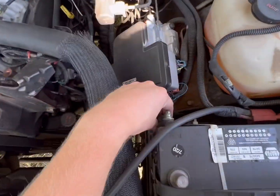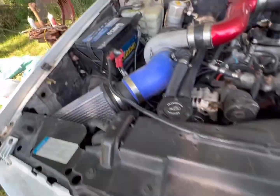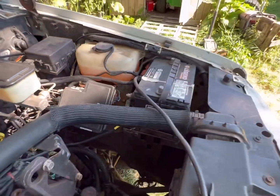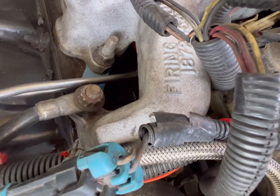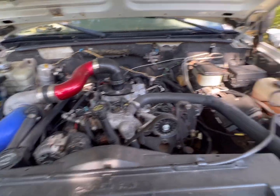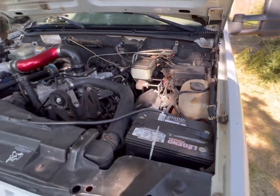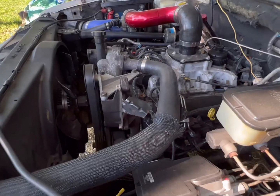We're going to start with the two battery cables. Make sure your crossover cable is good — it's not just a ground thing, it's a power thing. If these cables are torn up, you'll have issues. I always replace the grounds with ones from Tractor Supply; they're universal 36-inch. I re-ground them back to intake runner 1 and intake runner 2. That takes care of your battery and is the main source of your headaches. If you have a hard start issue or a slow crank, check those grounds on the batteries to the intake before you get too crazy with changing starters.